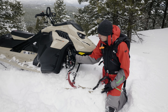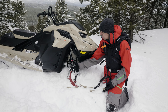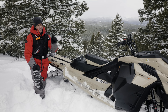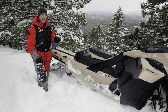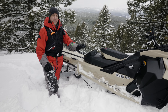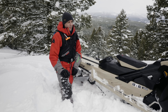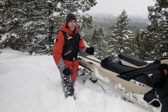The Summit X has the KYB 36 Plus shocks, and this is that lightweight spring right there — check out the gap between the springs — just keeping everything light and agile as much as they can for this particular model. This sled has the 34-inch ski stance, which is becoming more common throughout the Summit lineup. You could get a 34-inch ski stance on the Summit X in 2023 as well, and it's a great change — it really helps with side-hilling, just holding that sled on edge makes it a lot easier.